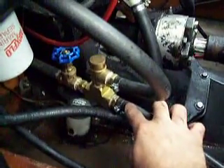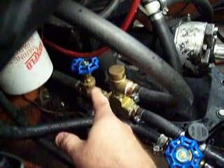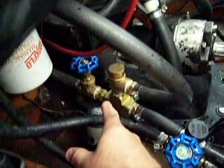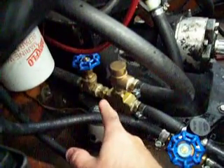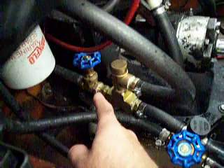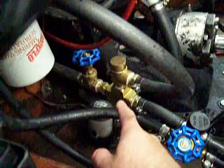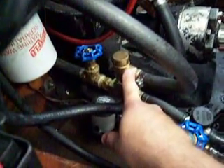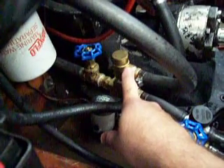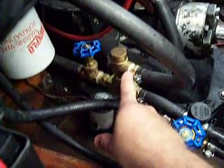Here's the water that goes into your engine. The water comes in through your jet back there into your gate valve, and you can adjust the water pressure coming into your engine through that. The best way to do this is to run your engine at idle and get your temperature between 160 and 180 degrees using the gate valve. Once you've adjusted your idle, then you have what's called a relief valve right here, and this relieves the pressure when it exceeds 15 pounds of pressure in your engine, keeping the pressure from building up inside your engine.